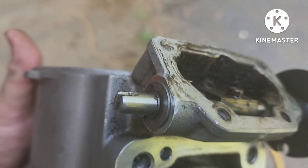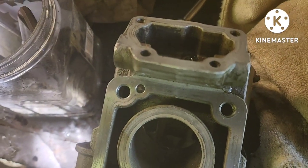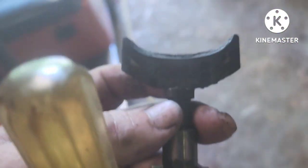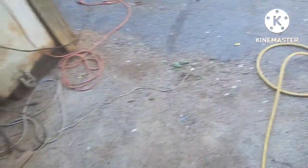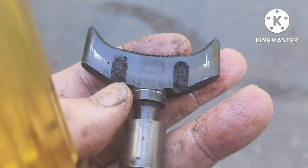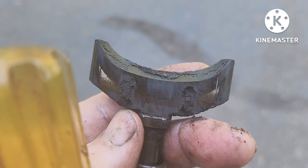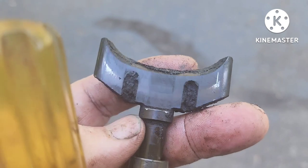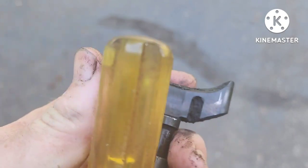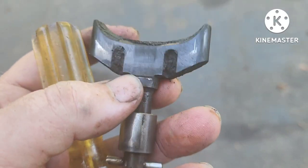Pull out the power valve — let's get in some light. My shop is a dirt-floor, bad-lighting shade tree shop, not the best for videoing. You can see I've got carbon build-up in those two slots and on that scalloped edge. I'm going to take a wire wheel brush on my drill and hit that, get all that carbon off. I'll probably also take a little screwdriver and chip it out of there.